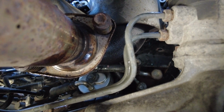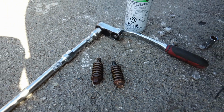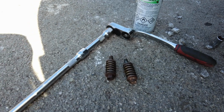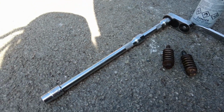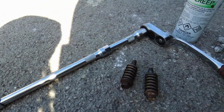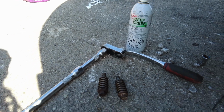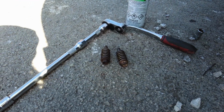The exhaust manifold bolts came out relatively easily. I ended up using a 1/2-inch ratchet with an extension bar and another extension bar and a 14mm socket to get access. I did deep creep everything as usual, and I'll put a link to that in the description. It works a treat.